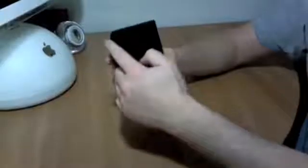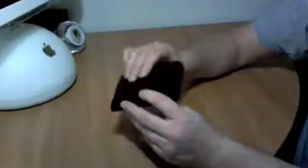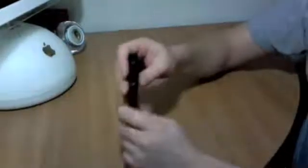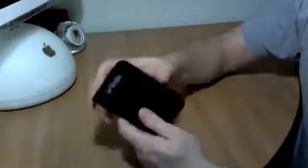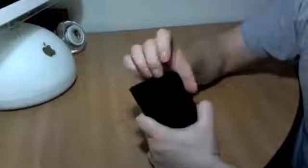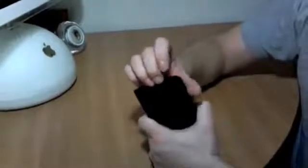It's the newer style that has rounded edges on two sides and more square edges on the other two sides. The trick to getting this apart is a little bit of edge cracking, and the rest is pretty simple. There are no screws at all on the device, so pretty much you're just going to be popping the edges around with your fingernail.